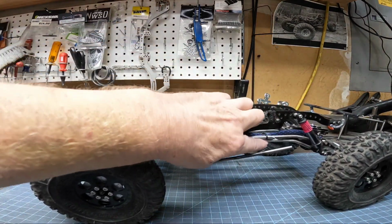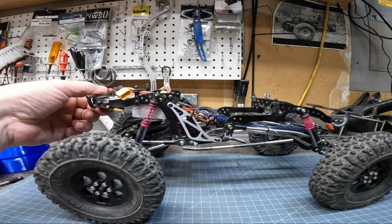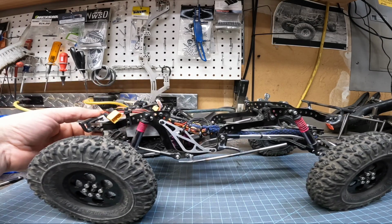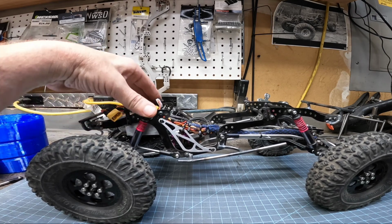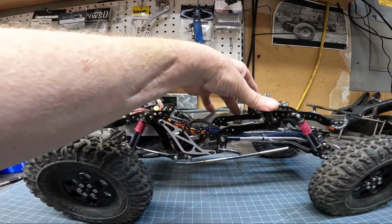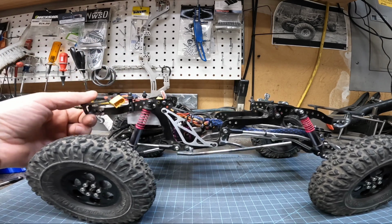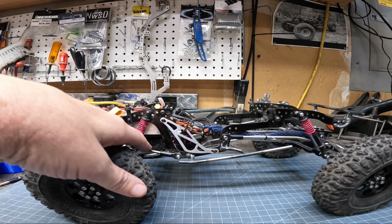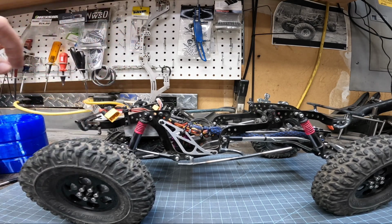So I'm gonna lengthen the rear, put different lower links and upper links, play with that whole setup. And the shocks, right now I got Dravtech, the mediums, so they're like 92.5 millimeters or whatever they are. But these are an old set of shocks, and I'm going to try something different. I really want to limit the travel on the front. These super short front links, I don't need a whole lot of travel. So I'm going to get another set of Dravtechs I'm going to put on there. Going to give it a go.